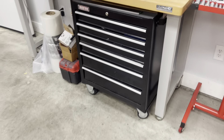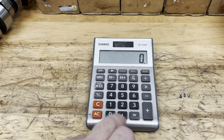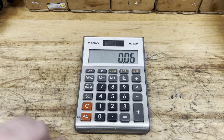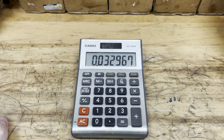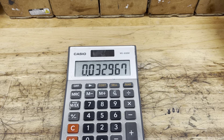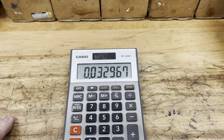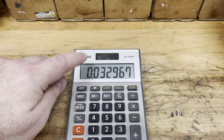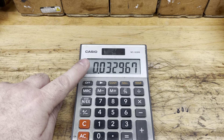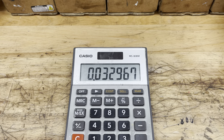We've got about 58 to 60 thousandths of lash in the system. Now, to figure out how far off the bottom we are: if we assume 0.060, and this is a 1.82 rocker arm, we divide 0.060 by 1.82 and we are just under 33 thousandths off the bottom of that lifter. Remember, this is not lifter travel — this is how far off the bottom the lifter currently sits.